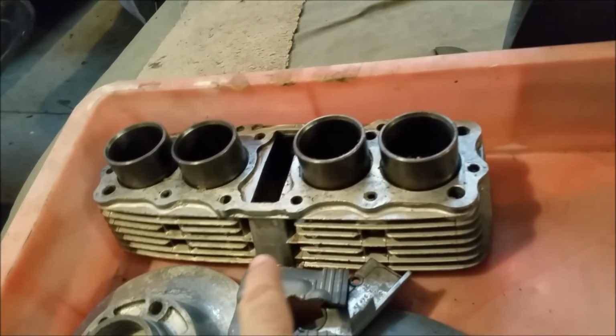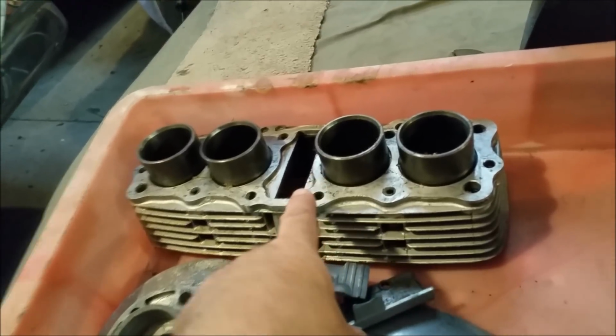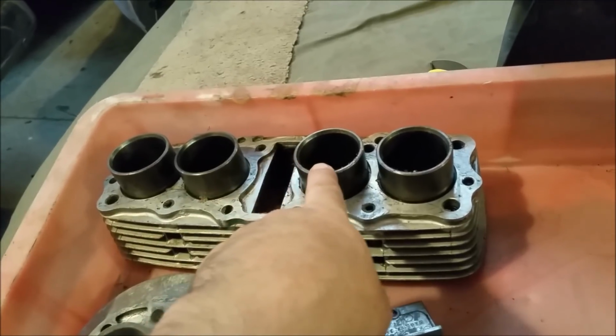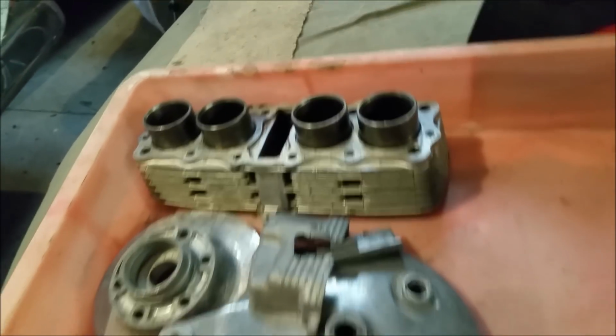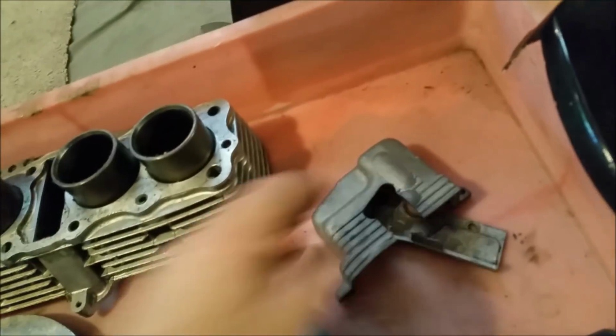The cylinders for the 350, I want to get them done before I hone them. And there's a reason for that, because hydroblasting doesn't take metal off, but it does peen it, so it'll disrupt the hone pattern once it's been bored. The oil pump bits and pieces probably don't really need it. I'll get these ears done and the brake components, but also this, because it's rusty behind there and I can't be bothered cleaning it up.